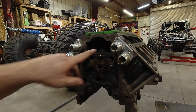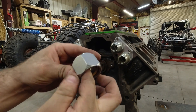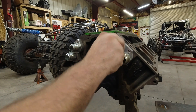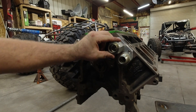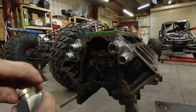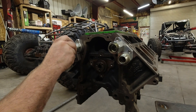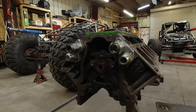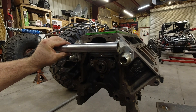The first part of this that's a little bit of a challenge is how to connect these. I talked to my local hydraulic shop and they had these fittings — they've got a steel collar on the inside and it's a female adapter. This is designed to just thread on right there. This does not require anything as that collar has the necessary bevel to seal the dash 16, because these are all dash 16. When that's installed, we simply need a way to connect these two together. Based on how they did it, they used tube. So I cut a piece of tube and now I'm going to figure out how I can connect this all together.